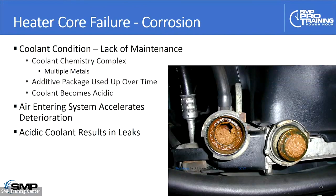Corrosion is generally a result of not servicing the cooling system — all the additives get used up over time, and you get a buildup of acid in the system. That can be accelerated by a bad radiator cap or air getting into the system. The presence of oxygen accelerates all kinds of chemical mischief and you end up with corrosion, which leads to solids building up that can clog cooling passages. If we're replacing the heater core, we need to correct for the effects of corrosion in the system.